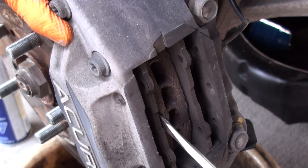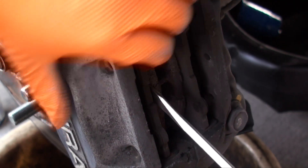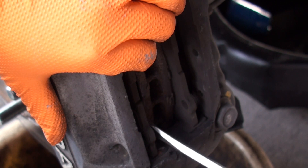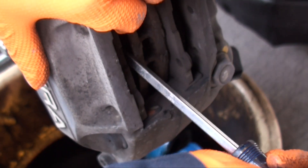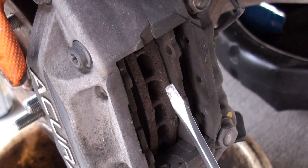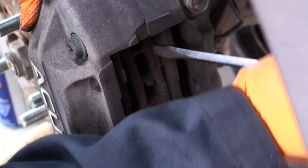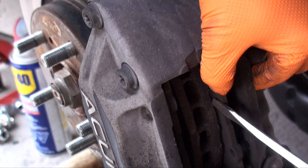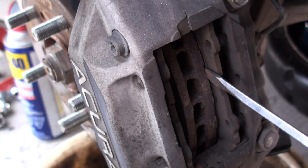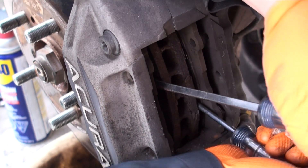On the Acura RLs, it's actually a quad-piston design — two on each side, one on top and one on the bottom. How we're going to retract it is to simply take our screwdriver and gently pry towards the outside edge of the caliper body. Do the same for the rears by giving the pads a good push towards the sides of the caliper and then repeating the process. Pay careful attention that you're not prying against the soft aluminum caliper body, but rather against the hardened steel rotor, which we're going to replace anyway. While simultaneously prying on both pads, retract the piston back into the caliper bore.